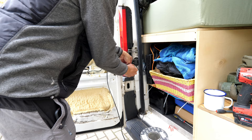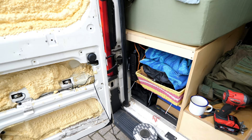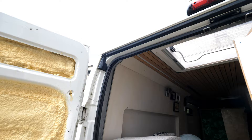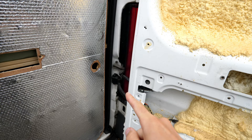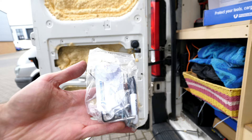Here I am just feeding a bit of extra cable. The cable they give you in the kit is not long enough — you need to get a bit of two-core cable to run all the way around the edge and into the other door, because you have to keep the Thunderbolt lock on one side but then use the other end of the cable to get all the way to the other door to hook into the wiring loom.